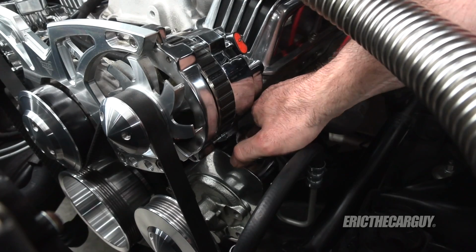So track down the source of that and you'll likely solve the power steering problem that you have. Also on fluid, some manufacturers are very specific about the type of fluid that goes into their system, so make sure that you're using the fluid that is recommended for your system. I know Hondas in particular, if you use anything but Honda power steering fluid, there's oftentimes issues, at least in my experience. So I only use Honda power steering fluid in Honda power steering systems.